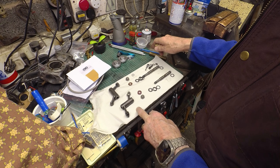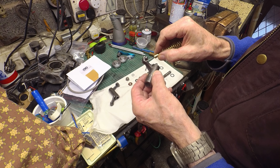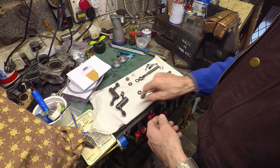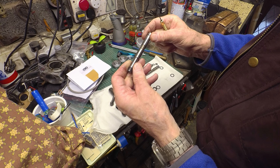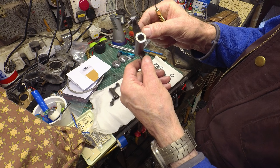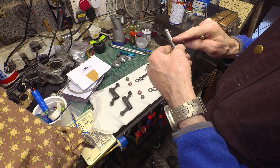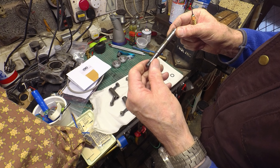I've got a new O-ring for the valve lifter. There's definitely a witness mark there — I'm not sure what's going on there. Whether the pushrod... no, it can't be the pushrod. The other thing is on this rocker shaft — there's some distinct scoring there, not enough to need to replace it I don't think, but definitely something going on there as well. Looking in here, there's maybe some slight scoring. I'll just touch that with a bit of wet and dry, just in case there's any bits still sticking up. Otherwise I'm going to reuse that.